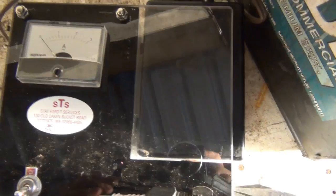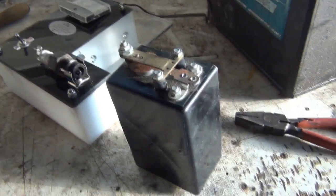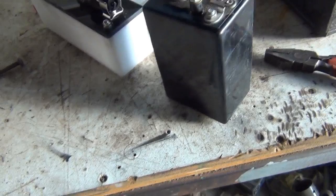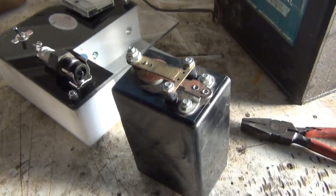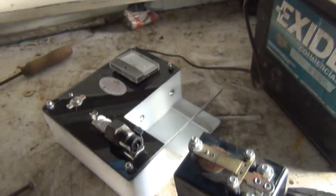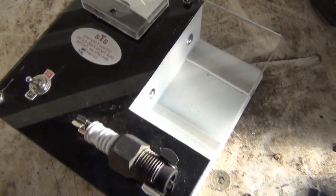And that is how you test your coil boxes. Very useful device to have. It is rather difficult to get these boxes working properly just by ear or by sight alone. A coil box tester is a life saver, and it's brilliant for recalibrating your coils. Not that they go out of adjustment much, but it is good for setting them when you first purchase new ones, because sometimes they're not quite set right.